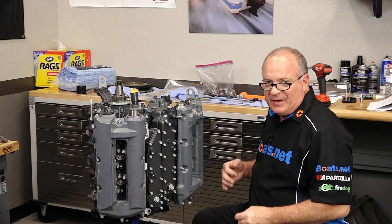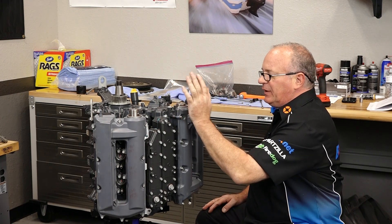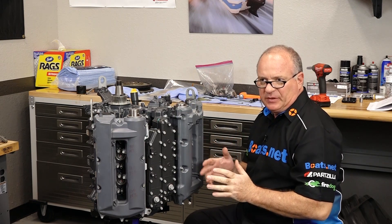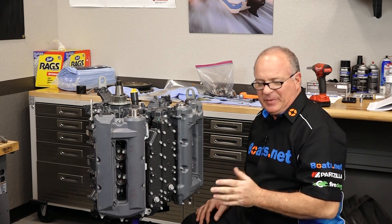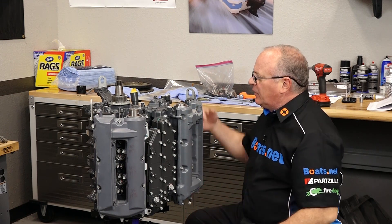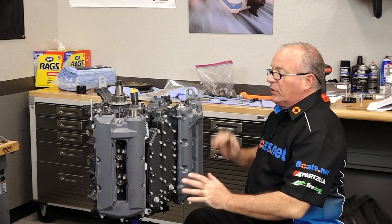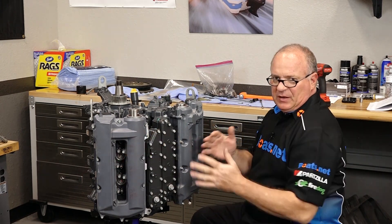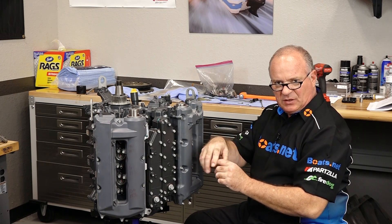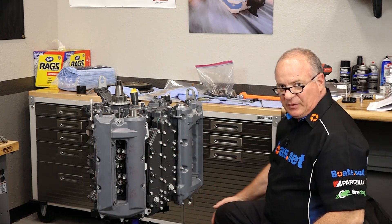We're going to start this process by actually going backwards for a moment. The first step is we need to go ahead and get our camshaft gears mounted, and to do that we need to hold the camshaft still because they take right at 49 foot-pounds of torque. We can't do that with the engine sitting like it is, and I don't want to put that kind of stress on the timing belt when I put it on. So we're going to remove these covers — on the camshaft there's an actual area where you can put a wrench to hold it still.